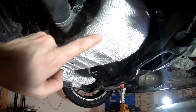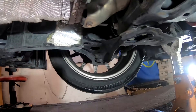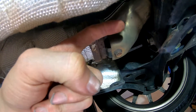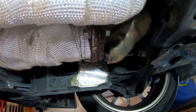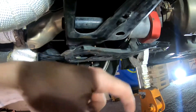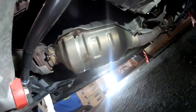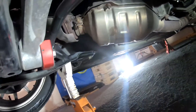Splitter and skid plate are off. You can see my nicely wrapped mystery header — still looks good. Now we can get to the uppipe. You can see where it bolts to the header here — just two bolts. On the factory header these are studs, but these are nuts and bolts on the aftermarket ones. Then it goes over the subframe and the rack and pinion and hooks up to the midpipe back there. Hopefully my big fat sway bar doesn't get in the way, and I might have to undo it from back there to give more clearance.